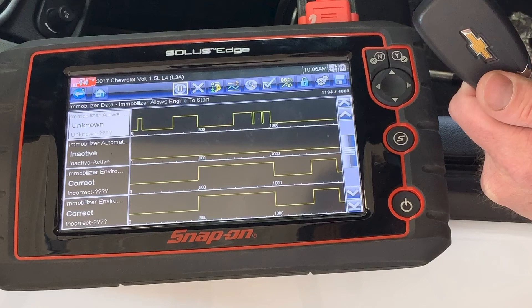You can see on the scan tool timeline that I was toggling between these states — a great way to understand what PIDs change based on key recognition using the foil trick. It's a great experiment even in the field if you're concerned or confused about what you're looking at, since the 'correct versus unknown' PID is not very descriptive. Different manufacturers handle this differently, and ultimately you want to understand it quickly to fix the issue or rule out the key as a concern. Make sure you hop on Cobra, check out the assignments this week, and thanks for watching.